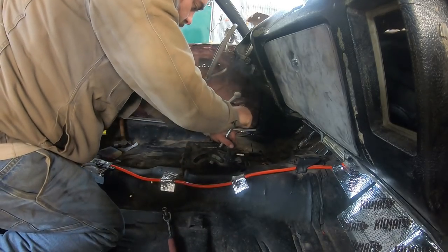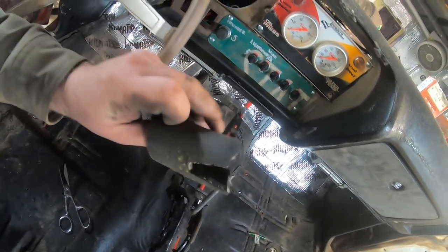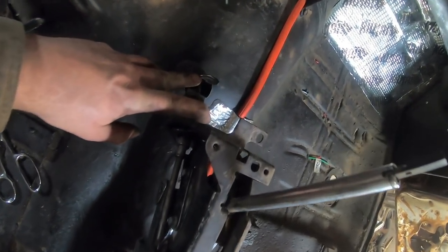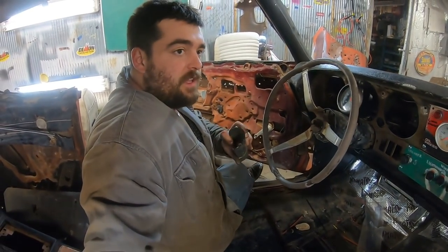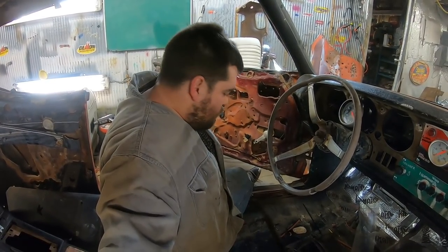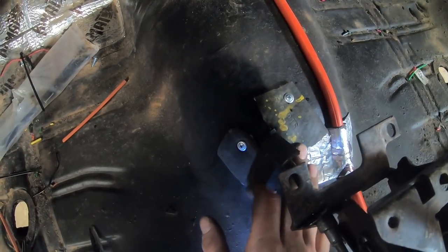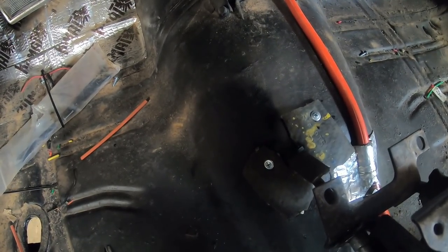Maybe if we use it enough, it'll come around for us. Our grommet is going to be made out of a chunk of radiator hose, and we'll just zip tie this little chunk right here to keep it from rubbing. Then we'll screw the bigger part around it. There's holes everywhere — that's how you can seal off a big old hole in your floor pan for free, as long as you have a stash of completely no-good hoses laying about like I do.